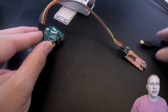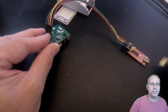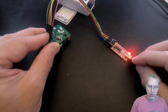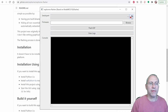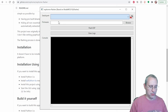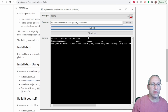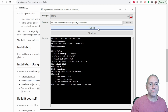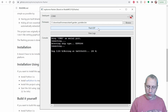I found with this particular model of Sonoff you need to hold the button down by pressing it against the table while you plug in the USB, otherwise it doesn't recognize that it's in flash mode. Even though I can select COM3 and my bin file, I will get an error message if I don't do this. When I do it properly it will flash, erase the old firmware, write the new one, and then start logging.